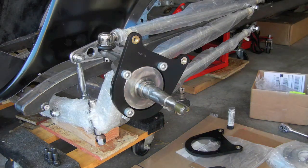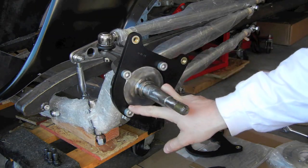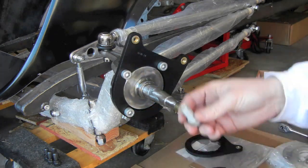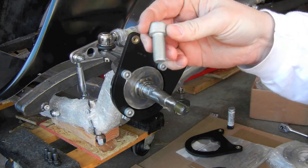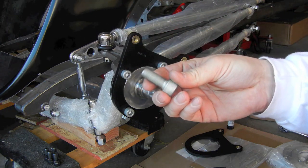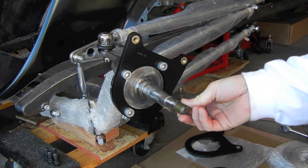I've got it all buttoned up. I went ahead and pulled all the bolts back out, put Nyloc nuts on them, and put them back in. One thing I noticed — especially on some of these bolts — is you may need to chase the threads down with a die to clean them up a little before putting them into the steering arm. That will help prevent anything from getting cross-threaded. The bracket is pretty much all on and so far, so good.